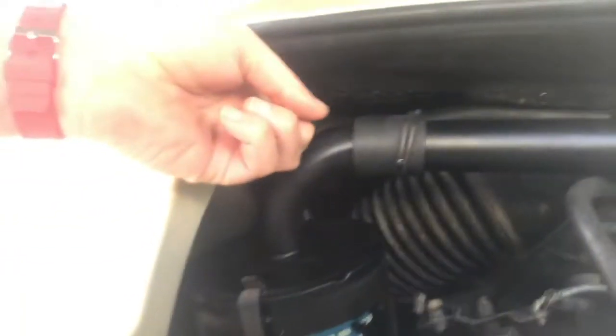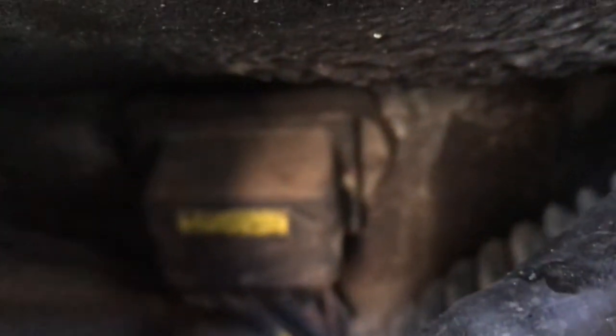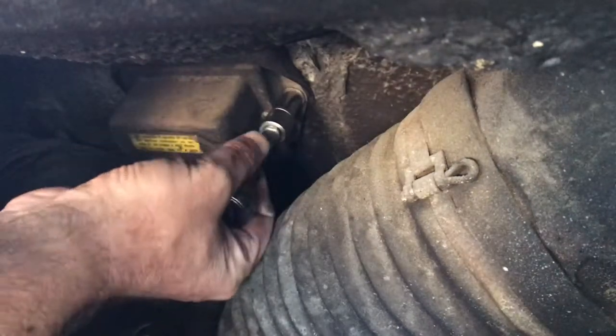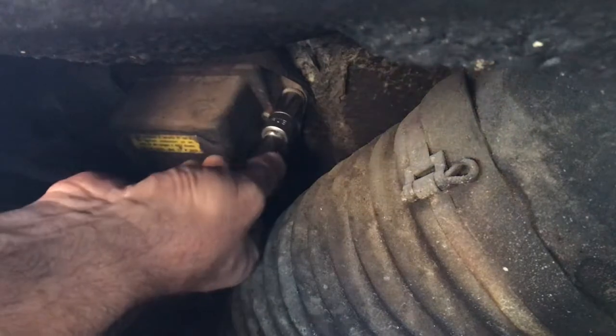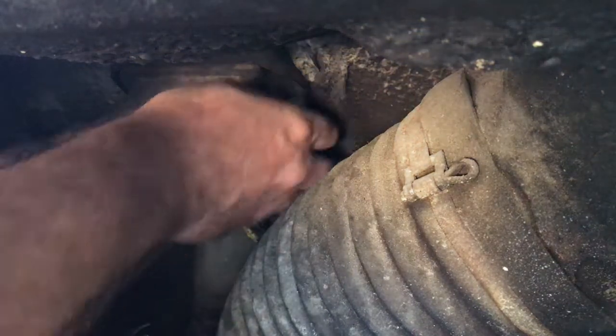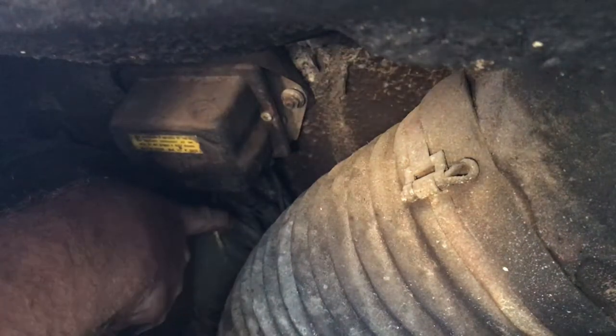It's here behind — I basically have to take off the filter. It's there in the back in the corners, it's very annoying to get to. So I'm going to disconnect the battery from the filter side. It's actually this box — it's difficult to get to. Two bolts and then the cables. I have to remove this first. It's bolt number 10. You have to be careful not to lose the bolts if they fall down. I already noted the cables — in my case, yellow on the left, red in the center.